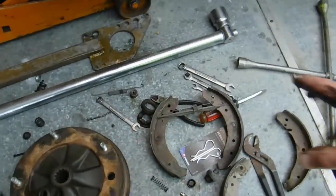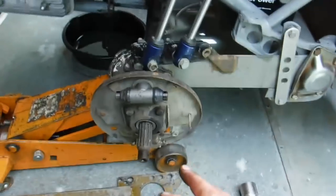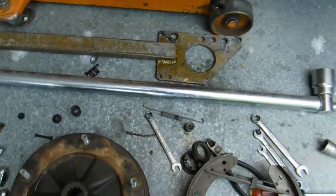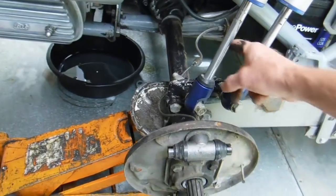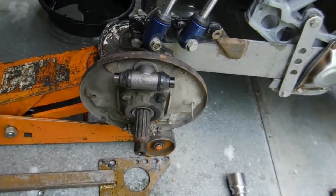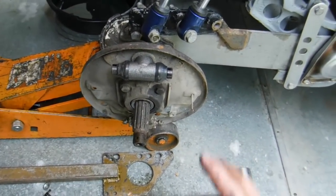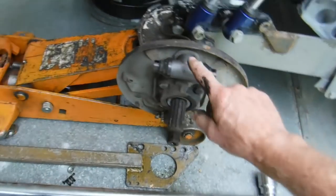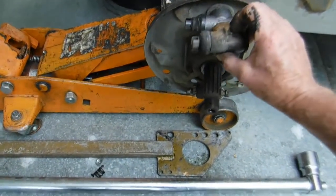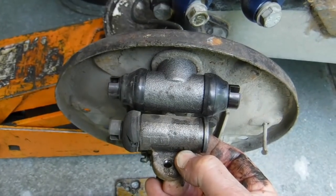It looks like a good drum, and I have an old set of shoes because I don't throw anything away. While I was in here messing with stuff, it looked like it had a new bleed valve on it. Somebody had put a stainless steel flex line on the back — that looks professional, like they spent some money. At O'Reilly Auto Parts, I have a hub store right close to me. This is a front wheel cylinder — I took the rear wheel cylinder, and I don't know if you can tell the difference on camera, but the top one is 22 millimeter and the bottom one is 19 millimeter.